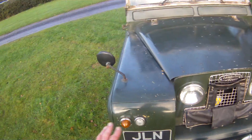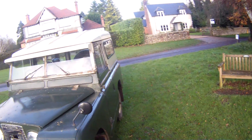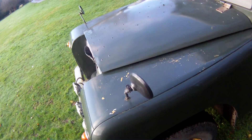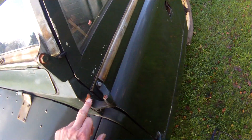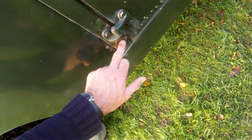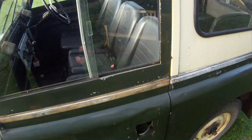Around the front end, there are lots of areas where the sand colour is coming through, especially on the wing tops — the wing tops are a little bit rough. But looking down the nearside, apart from the usual dinks in the barrel sides and stuff on the doors, she's actually really quite straight. Wing front is good. Up on the scuttle corner it looks like it's had some work, probably a bit of filler in there, but the original spot weld marks are still visible so it hasn't gone too far in. Along the base it's just starting to corrode underneath the bottom hinge pin, but it still feels quite solid — just the surface has come off. Electrolytic reaction on both door bottoms. I think they are aluminium door tops because you can see where the paint has come off, so they're not going to rust.